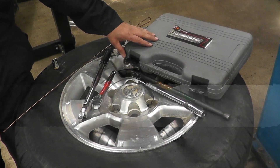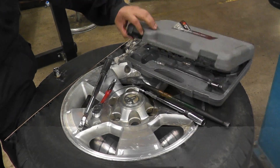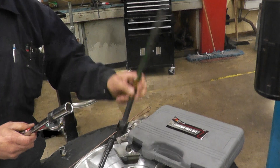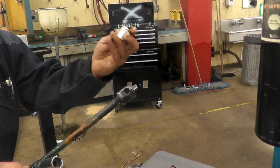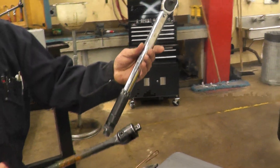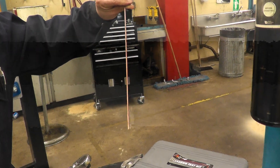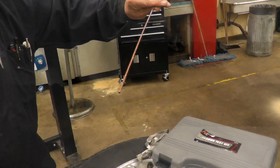For this test, the tools you're going to need: the leak down gauge, a spark plug socket, a 3/8 ratchet, a breaker bar to spin the crankshaft. For this particular engine you're going to need a 17mm socket that fits on the crankshaft, a torque wrench to put the plugs back in, and a rod to find out when we're at top dead center. Let's get rolling.